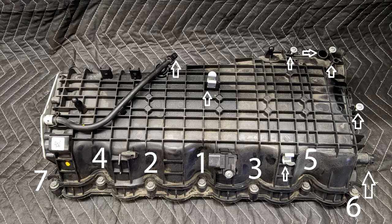Come up to the top and remove all of the accessories and things connected to the intake plenum — any bolts holding the wiring harness down leading over to the DME, the hard plastic line that comes out of the intake manifold over to the fuel tank breather valve, and miscellaneous wiring harnesses going over to that breather valve and across the intake.